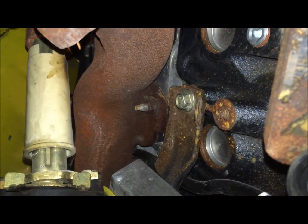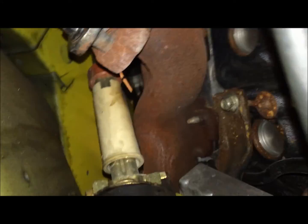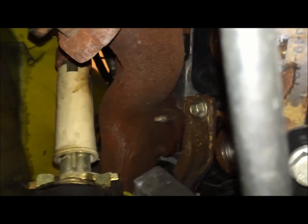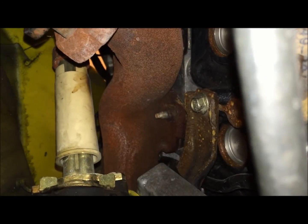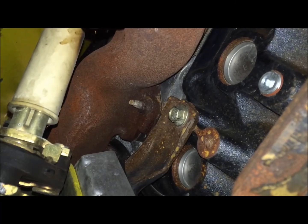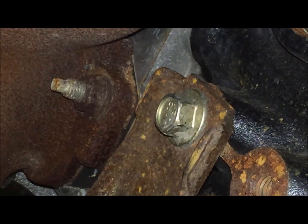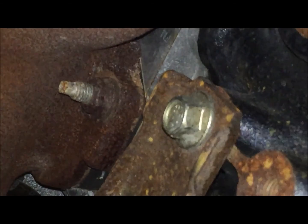We can leave the other one in place. The ground wire going to the battery is going to go from the rear motor mount bolt, up around the steering column, and then back up toward the negative battery terminal. I'm going to take a 13mm socket and take off this motor mount bolt — that's where we're going to do the ground.